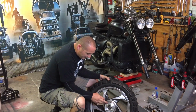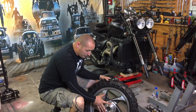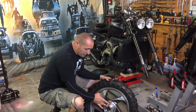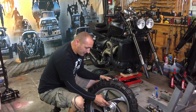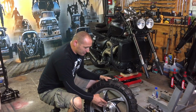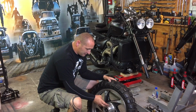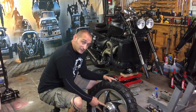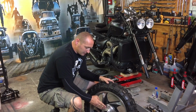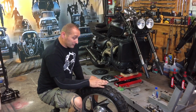And it's very important where the rotors sit on the wheel. You definitely have to cover that, because you don't want any paint going under the rotor. You just never know, we're talking about microns, very thin layers are enough, and the rotor is not completely smoothly connected to the wheel anymore.